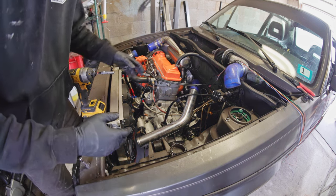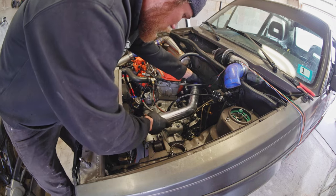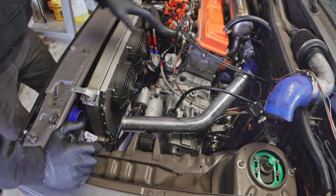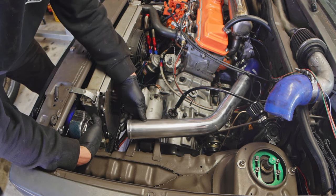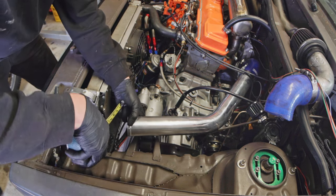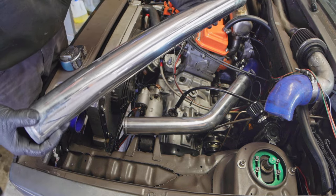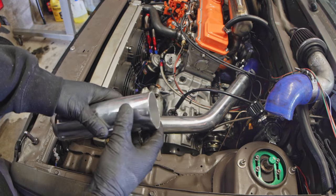New piping — you still have to get from here to there. It's looking like the first section should be this long tube, and then I'll use another straight section. I got this first section of pipe in and it looks pretty good. I just need to measure another straight section; the slight angle should be taken up by the boost coupler. An eight-inch piece of pipe will do quite nicely. I'm going to measure eight inches, cut it with my angle grinder, and clean it out. Here's my cut-down tube — I chopped it with the angle grinder, it didn't come out quite straight, but it doesn't matter.